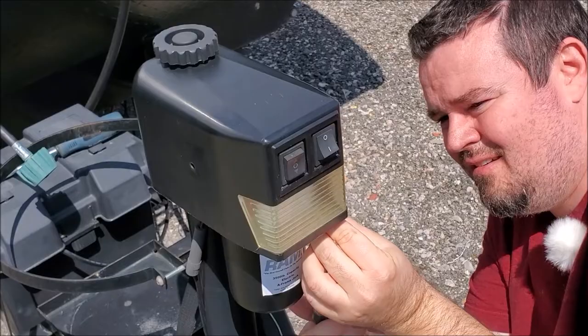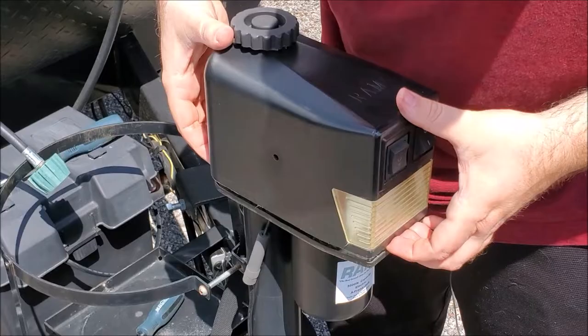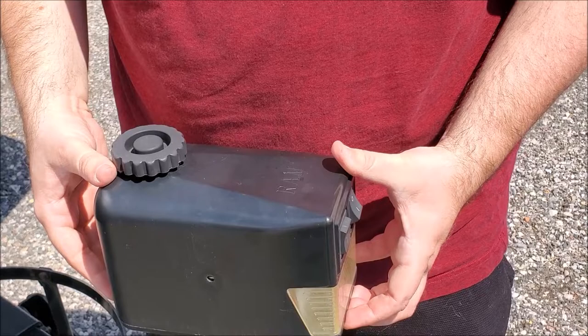We took out two silver Phillips screws from underneath and now the cover is starting to come off. One caveat to this job: in behind here there's circuitry, and the wires used to connect to the switch are very short. You want to be careful you don't break the wires because that would be a disaster. Also, I'd only recommend doing this job on a nice warm day — if you do it on a cold day and the wires are stiff and brittle, you could snap the connections right off.